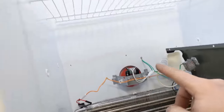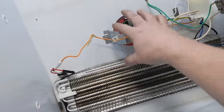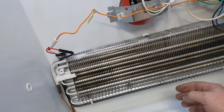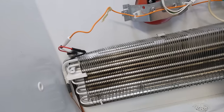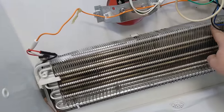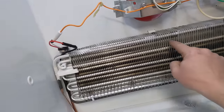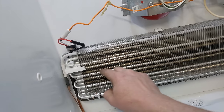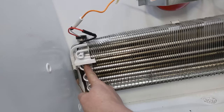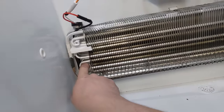It's actually not working exactly like it should because this acts as a deflector. So now it's just pulling air from everywhere instead of across the actual cooling fins. So you can see we're icing up. It comes across this top one, back, it stays on the front. Oh no, then it goes back through there and then up to here, but I'm icing up three down. I guess that's five down. So yeah, we're icing up good.